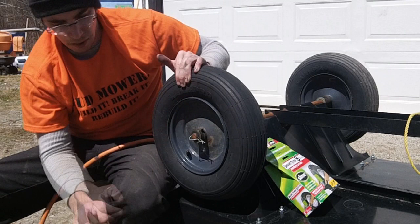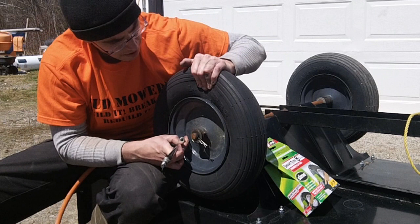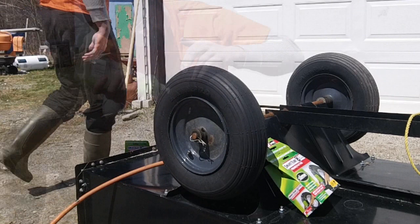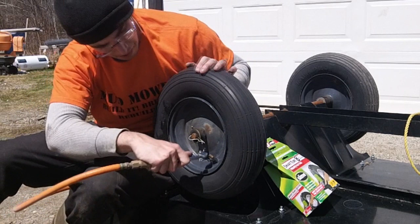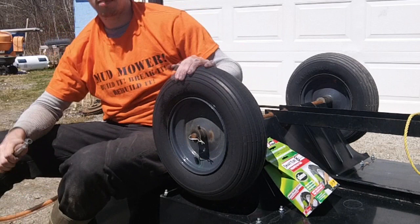What I'm going to do is drain some of the air, then set the bead back in. The easy way is just to undo the valve and press it. That let the bead go down. Grab some Dawn dish soap, lube it up, and try again. Pop — there we go! The tire is all nice and solid and ready to go. Thanks everybody, have a nice day!